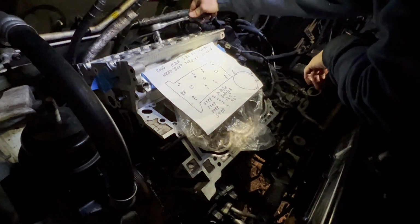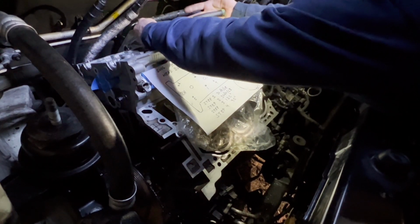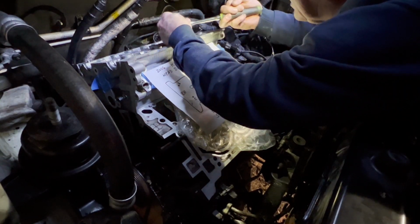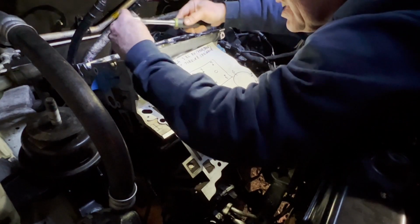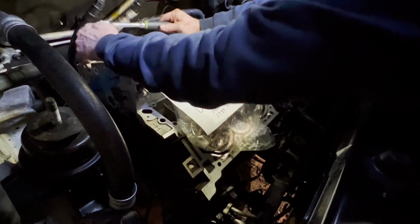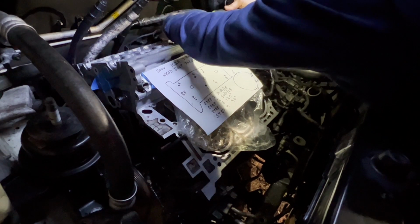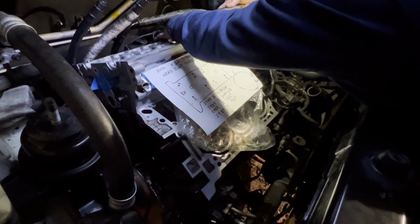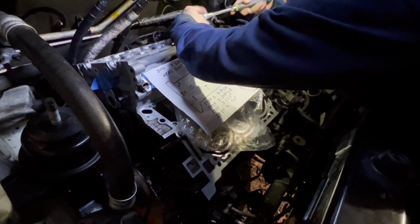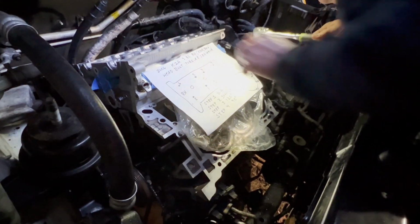Okay, for this last round of snugging with the ratchet, let's do it like this. Hold it like this, and then just like that, and then stop, okay? So let's go. This one's not been done yet. Just trying to snug them. As soon as it stops, stop. Because if you start going too crazy on it, then you're going to actually start putting in uneven, unmeasured torque. I'd say that's probably about 15 pounds of torque that I have on it.